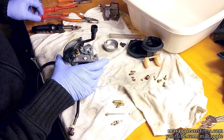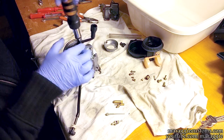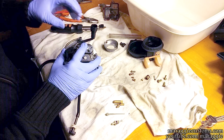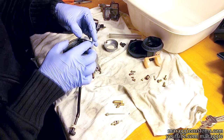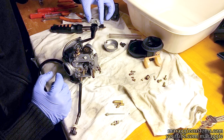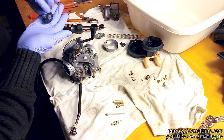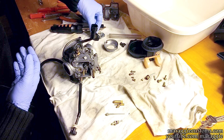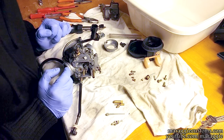While we're at it, we'll remove the choke valve cover. Be careful with this one as it is spring-loaded — so gently, and I mean very gently, because you have a diaphragm underneath here. There we go, that lifts up. You should be able to take the diaphragm off as well — I don't think I need to tell you how careful you need to be with that. As you can see there's a tiny ball bearing over there, and you have extra passages here to take care of.